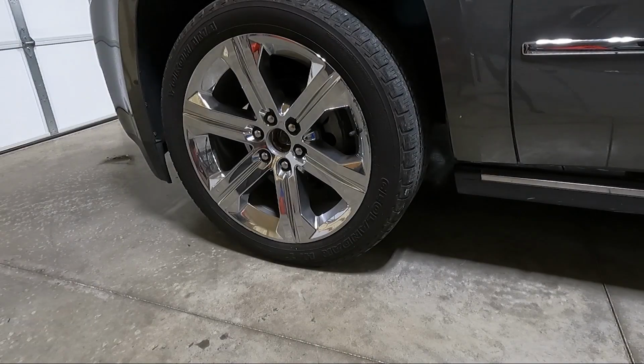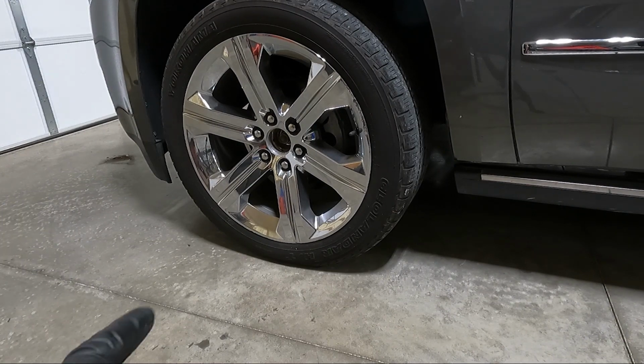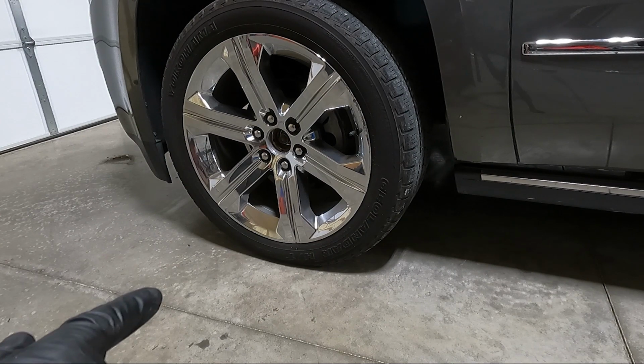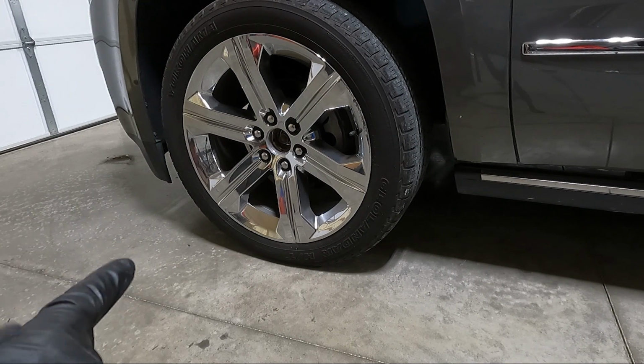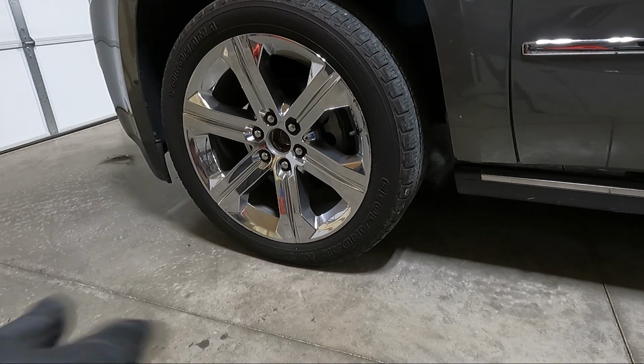As you can see, I got the wheel back on, it's on the ground, but you also notice, like I said, that center cap's out. So we're gonna do a couple things. We need to torque that center nut for that axle. That needs to be torqued to 177, like I said earlier. And then I'm gonna go ahead and torque all the wheels as well. I generally torque them down to 100.